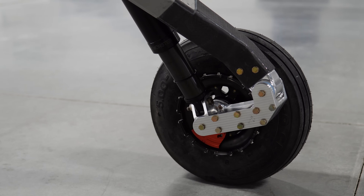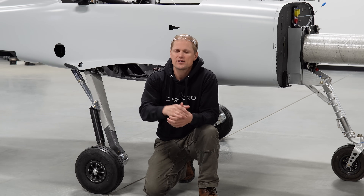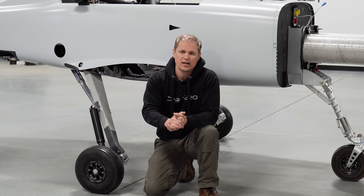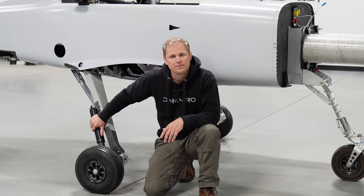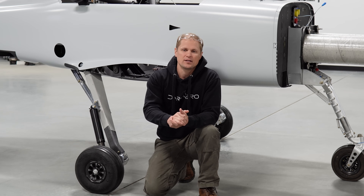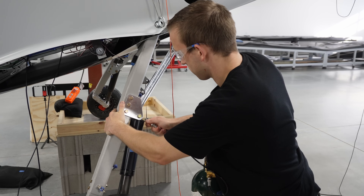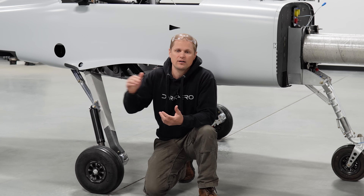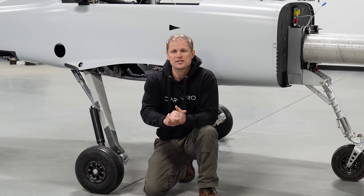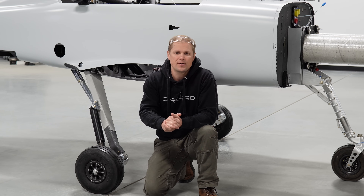We've highlighted the landing gear design in other videos, but I'll talk about it again here. It's a trailing link suspension with an off-the-shelf air shock. The big appeal with trailing link suspension is that it makes it a little bit easier to achieve smooth landings without bouncing the aircraft compared to some other designs. With this off-the-shelf air shock, there's a lot that we can tweak to get good landing performance — we can change the pressure in the shock to give different spring rates, and we can also modify the internal valving to give different damping on rebound. Drop testing gives us a systematic way to dial in these shock variables and ultimately optimize its performance.